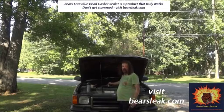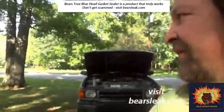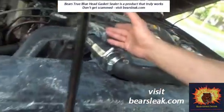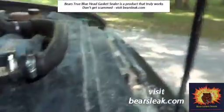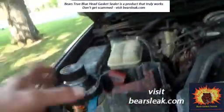Full oil, full water, and I bled it properly once I put the Bar's Leak in — made sure there was no air in it. Once I passed this device up here, I opened up the bleed screw, put in the correct amount of fluid — 13.7 quarts. About four blocks before getting home it blew, right off of here — blew the radiator hose and this Bar's Leak nonsense blew all over everything.